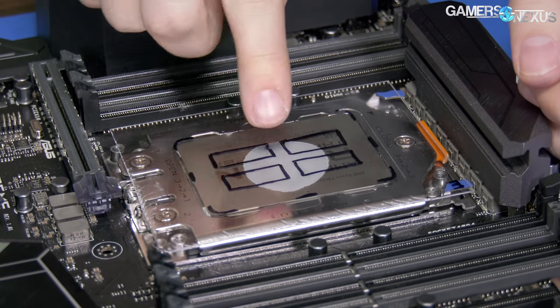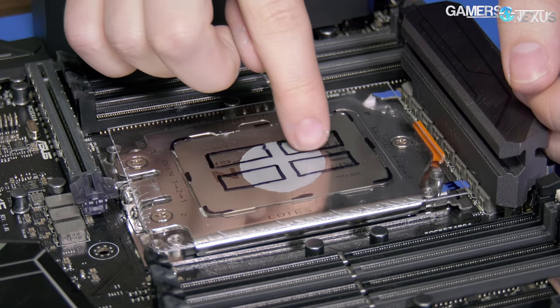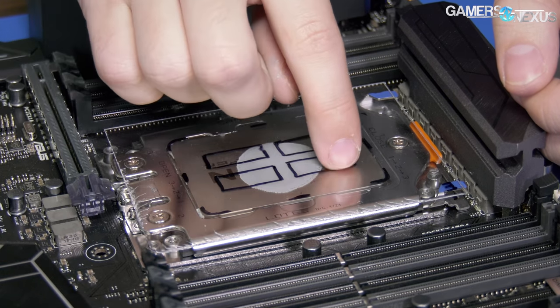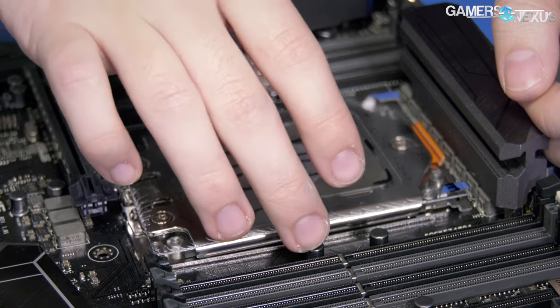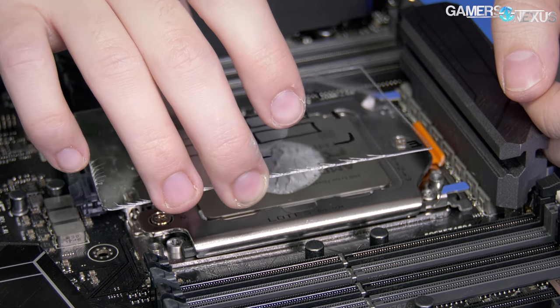So that's what the blob gets you. If we look at the dies, we're not covering a whole lot here — we get about half of each of them. That's going to be suboptimal transfer. You might be fine if the cold plate is still touching the outer areas since you're still pulling heat off them, but this isn't about being fine. It's about what's most efficient, which is what we're looking into today. Maybe it's totally irrelevant — we'll find out in the results section.